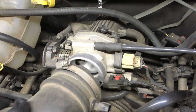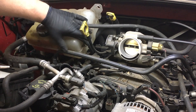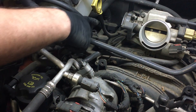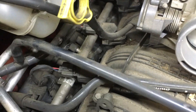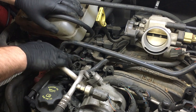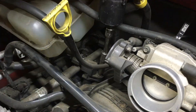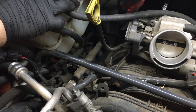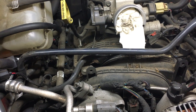What we're going to do is take these three coil packs off — they have a 10 millimeter nut right here. We'll take that 10 millimeter nut off and this whole thing will just lift out. I don't think we'll have to unplug them; there's plenty of slack. So I'm going to go ahead and take those off and then we'll get to the spark plugs.